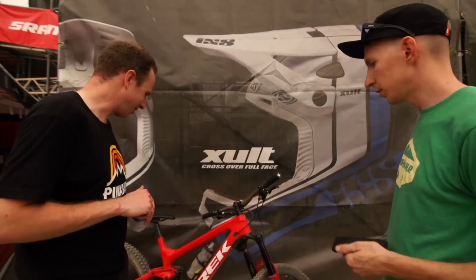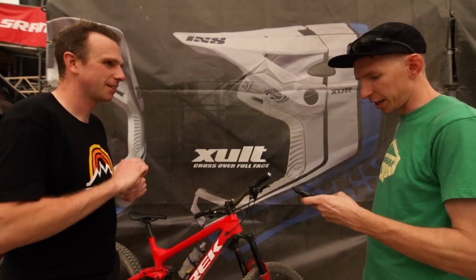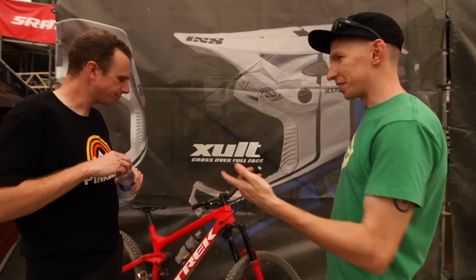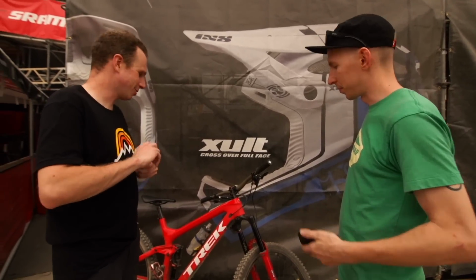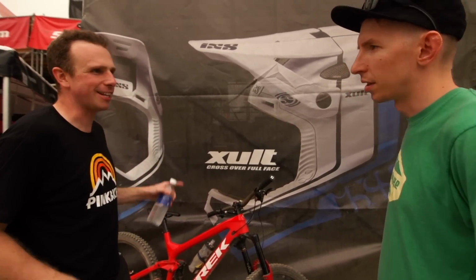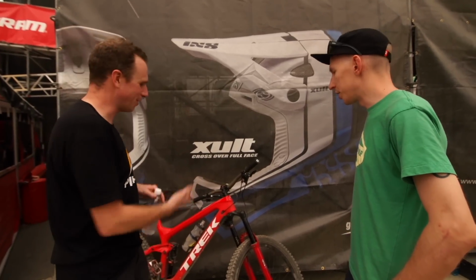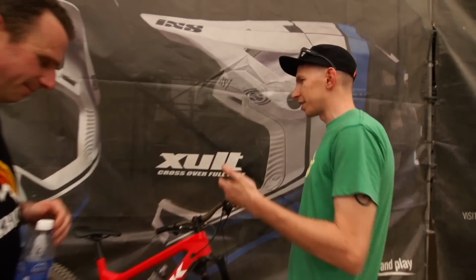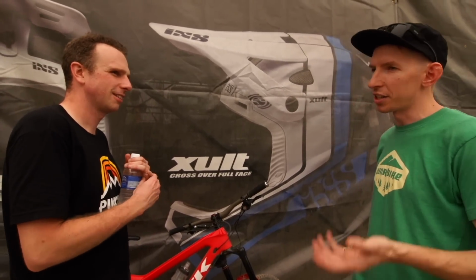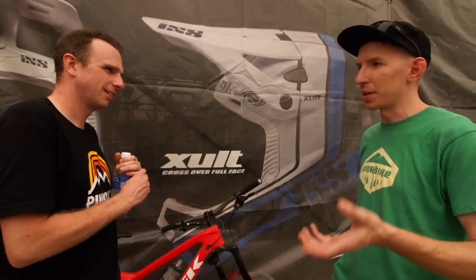Definitely. Your score for that was still a little lower, but 100 on ShockWiz doesn't mean it's going to be 100 for you and what you want. Yeah, that's true. I did prefer just on feel having fewer tokens and more air. There are different theories about this, but you can always add a little bit more low speed compression. That's not really the way you should bring your ride height up, but it kind of does work.